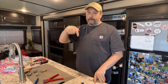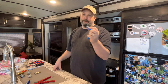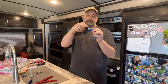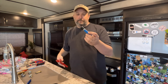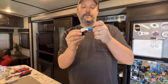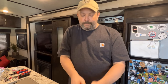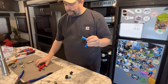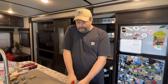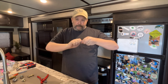Now I'll show you how to use the cutter — I know it sounds easy but let me show you a couple things, then I'll show you how to crimp one of these back on. Take your cutter, figure out where the fitting is inside, and make sure you cut back far enough. It's that easy — just make sure it's a good clean cut all the way around. I cut that one slightly at an angle because I wasn't looking, but there we go — make sure it's good and clean.